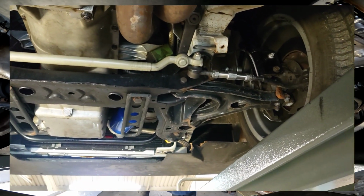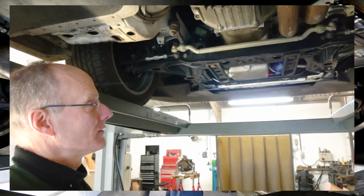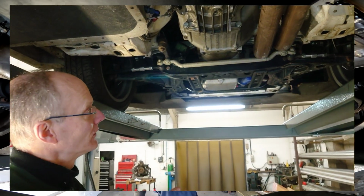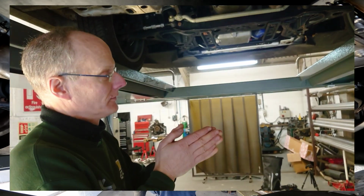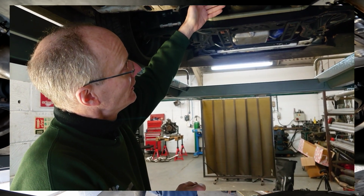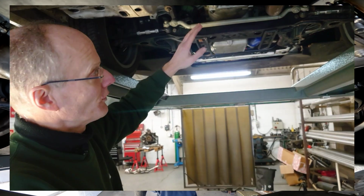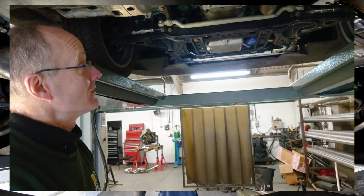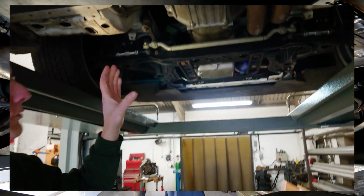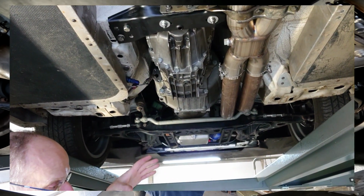And then the biggest difference was probably lightweight flywheel and clutch. We knew that the standard clutch, and particularly the pivot pin and fork arrangement, because it's a pull type clutch on a Lotus, so you're pulling the diaphragm, and there's a fork which pivots on the bell housing about here. And that pivot pin in the bell housing is a weak point. The pivot pins break, the forks break. Lotus went through various iterations, but it's always been a weak link, and when it fails, you're just stranded at the side of the road. So we put a lightweight flywheel to get rid of the dual mass flywheel, which was a monstrous thing.